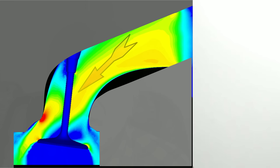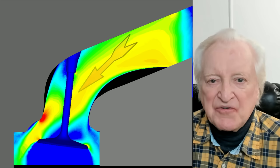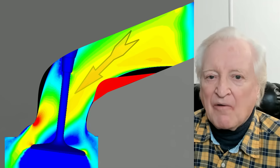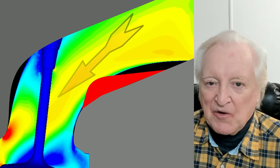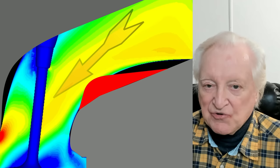So how can we apply those speed bumps to the port? I'm going to treat the short side turn as if it was part of the perimeter of an aircraft cowling and take one of those black streamlining shapes from the very edge of the cowling and apply it to that short side turn. The diagram shows the side and plan view of that speed bump, which should make things totally clear.